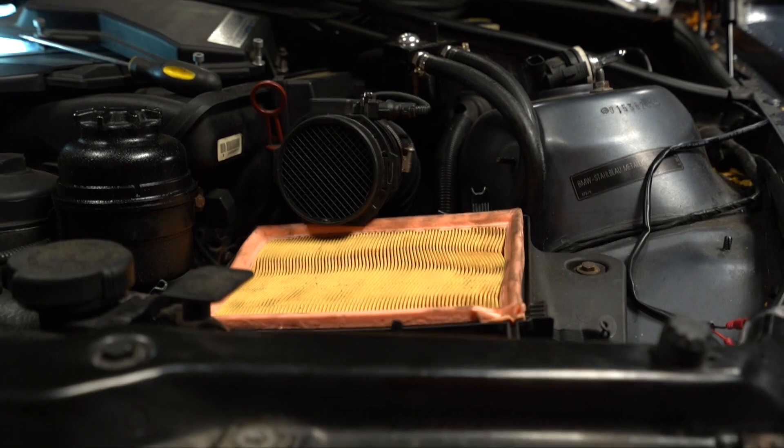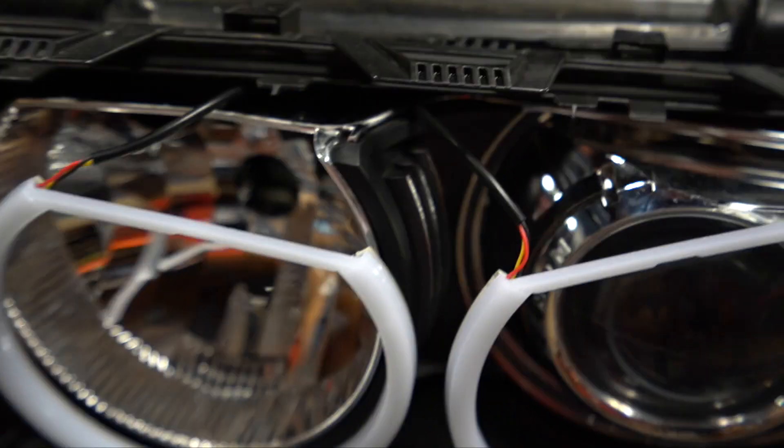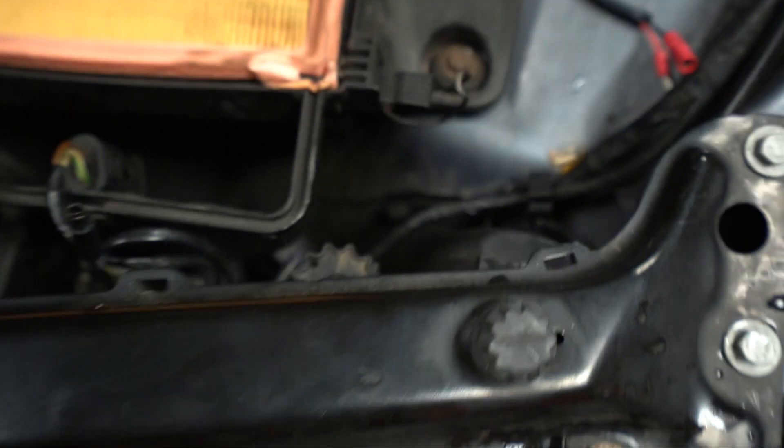I have now snaked the cables through the light. If you're working on this side I definitely suggest removing the air box, but you don't need to remove the headlights. You want to take the cable and snake it up right in the middle there — that's the biggest spot — and then just push it to the back and come over to the back of your headlight.